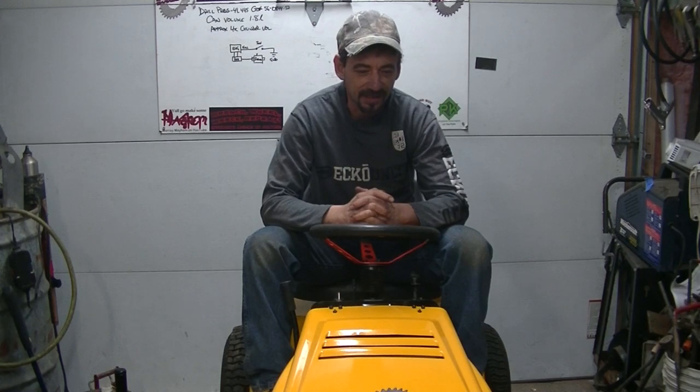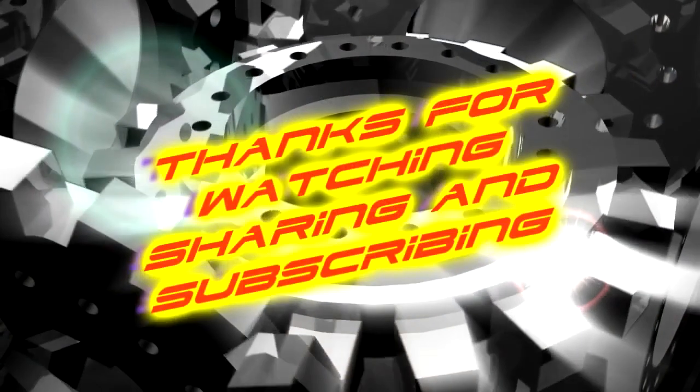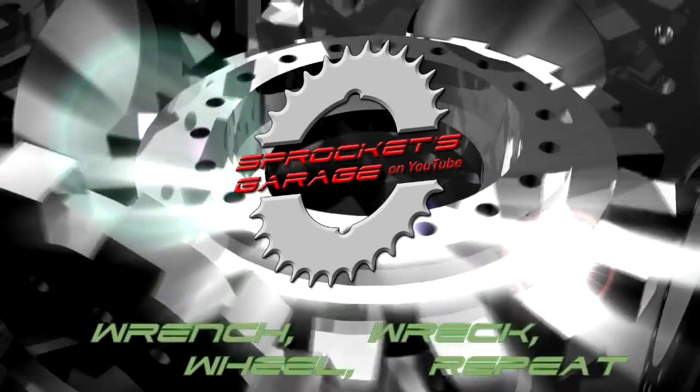All right folks, that takes it as far as I need to take it today. That's your basic wiring. I have only one thing left to address with regards to wiring on this machine, and that's some headlights. I'm going to be doing an LED headlight install very, very soon, so stay tuned for that. In the meantime, that's your basic starting, charging, and kill circuits that can be applied to not only any Murray wide body, but pretty much any lawn tractor, because they all boil down to the same thing. Some of the connections may look a little different, you may have an unregulated charging system, but at the end of the day it all parlays down to the same thing. That is your very, very basic simplified wiring for any off-road modified lawn tractor. Thanks for tuning into Sprockets Garage on YouTube, and until next time, take care of yourself. I'll see you in the next one.